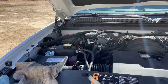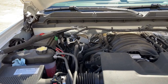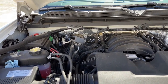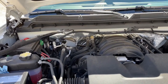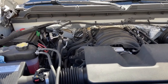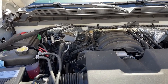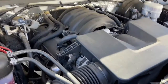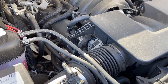When I first bought this truck, I bought it with almost 80,000 miles on it. It had a transmission flush done at about 58 or 59, according to the Carfax. Shortly after I got it, I went ahead and changed the fluid twice. The very first time, I found a decent amount of friction material on the magnets in the transmission pan. I kind of had a feeling that that was indicative of some issues with the clutch packs wearing down.